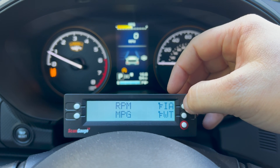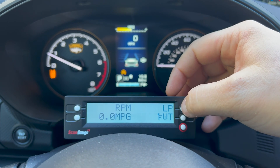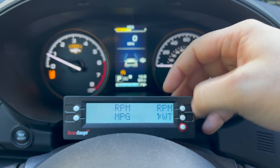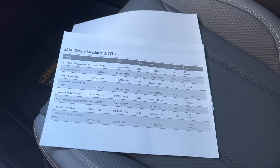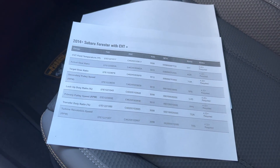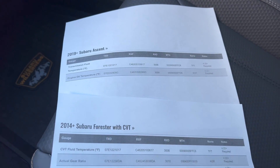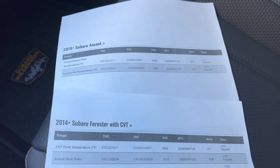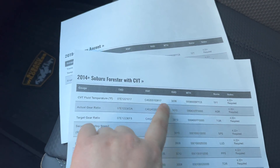The two that I really want to add are engine oil temperature and transmission oil temperature. I'm going to pull those down from ScanGauge's website and show you how to type in the codes — it's kind of like an old school video game cheat code. Here are all the codes you can type in for a 2014-plus Subaru Forester that has a CVT. The transmission oil temperature is the first one, but missing from this list is engine oil temperature. I learned from OC Turbo Joe that you can actually steal that code from the Subaru Ascent. An interesting thing is that the transmission fluid temperature codes are the exact same, so there's a lot of cross-compatibility between Subarus.